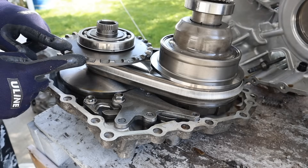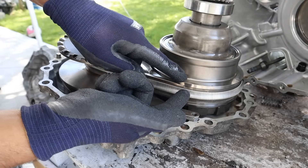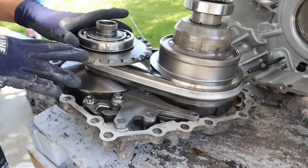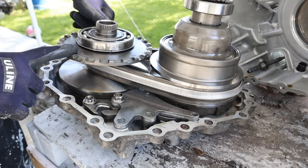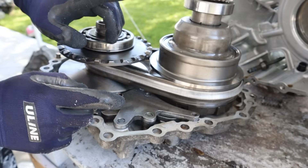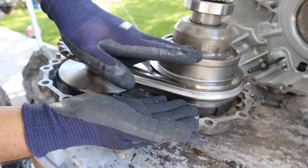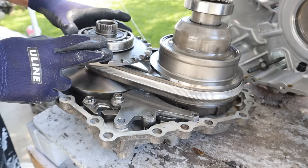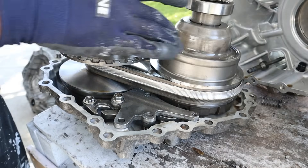In order to change the drive ratio you have to vary this distance by pushing these cones closer together on one side and spreading them further apart on the other side. It's all about pressure — the valve body puts pressure into this variator, and as you squeeze it, it's going to force the belt to move out. At the same time you have to relax the pressure inside the other one so it spreads open and the belt rides on a shorter radius. If you have a larger radius on the driving side and a shorter radius on the final drive side, that's how you get a speed increase, which is helpful in an overdrive scenario like going down the highway.